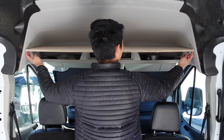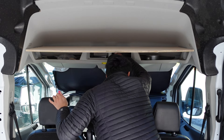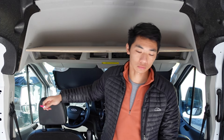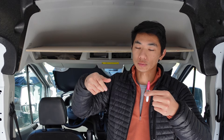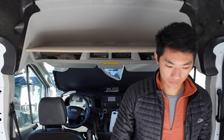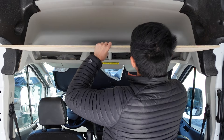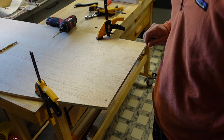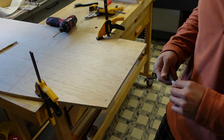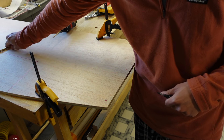Make sure we're still square. Take our marker. One in the center. In their instructions, you could also just grab some pliers and give it a little tap to reach in the hard areas. It's time to drill our holes. On the sides you're going to use a 7/32. And then in the center you're going to use a 9/32. If you don't have that, they say to size up — I didn't have a 9/32, so I went with the 5/16.